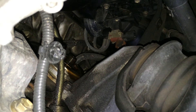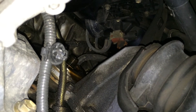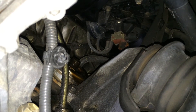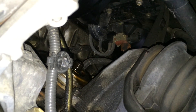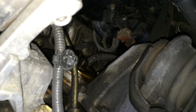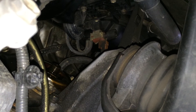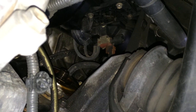What I've heard is to remove the two vacuum lines and block them off. Leave the valve connected — just literally undo the two vacuum lines and block off all the ends. Hopefully we'll leave the valve on the short intake tract, which is apparently what you want. That little kick you feel at about 4,500 RPM is the ACIS — I forget whether it's opening or closing — but it's switching over to the short air intake from the long runner intake.